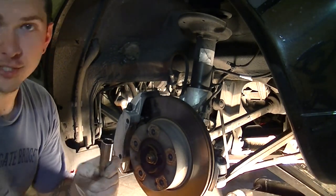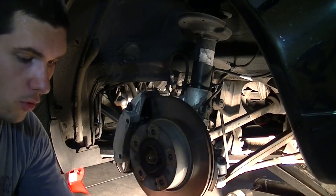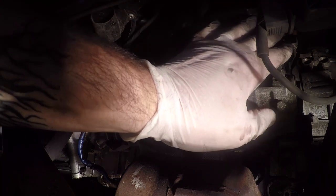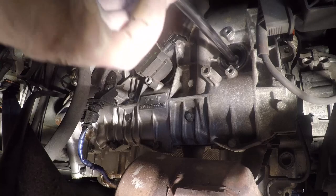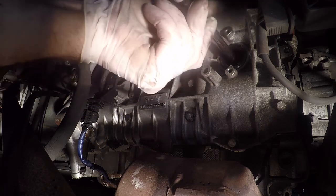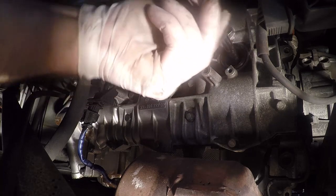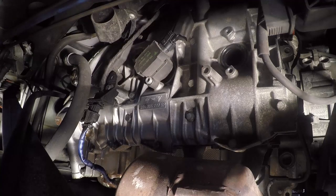Get your new one and put it back in. For my car I went with the Bosch Super — it was the recommended spark plug for the car. Just take it out of the box and literally do the exact opposite. Slide it on, put it into place, and be careful not to knock the head against anything — guide it in carefully without hitting the side of the block. Thread it as much as you can with your fingers, then torque it down to 21 foot-pounds.